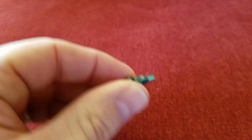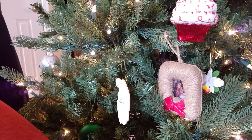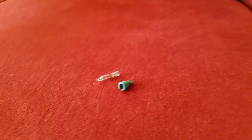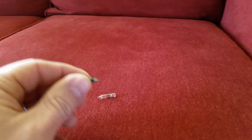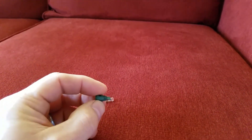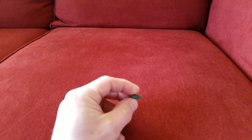From a troubleshooting standpoint, you could still have a situation where just one wire was broken off and the bulb was still physically attached in the socket. So you can't just pull on every bulb in a bad strand to fix it. But what you can do — and it's a bit challenging to get these bulbs out — is remove the bulb completely. If you remove the bad bulb, the internal shunt in the socket should engage and the strand should light up.